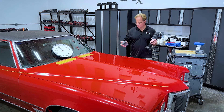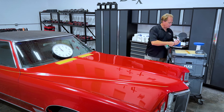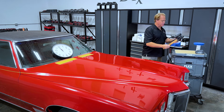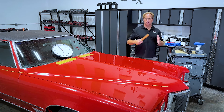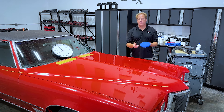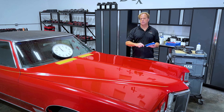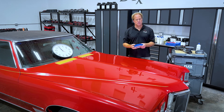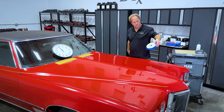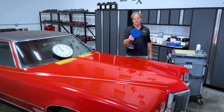Let's take a look at the new 24-volt Sea Beast in action. First thing, I just want to show that this is a fully charged brand new battery just off the charger. I went ahead and got a little ruler — the backing plate that comes with it is right at 5 and three-quarters of an inch. They call it a 6-inch backing plate. Usually when you make a backing plate, you make it a little undersized from what you advertise, because when you go to fit it on the pad you need to be able to see how to center it up.